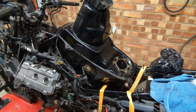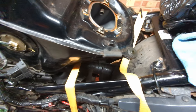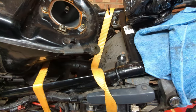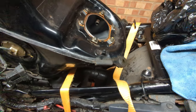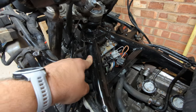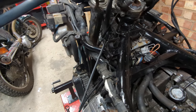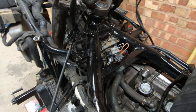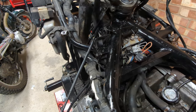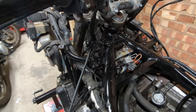The other thing I've done is started going around the frame, tidying up the rust scabs and spots in the joints - grinding them back to bare metal, adding some rust deactivator/rust inhibitor, then spraying over with rust-inhibiting zinc-based primer and black, or in some cases some direct-to-rust paint as well. Belt and braces.